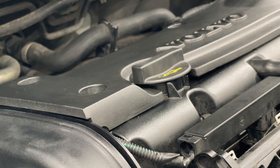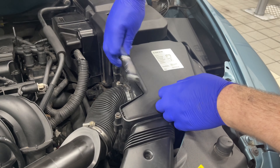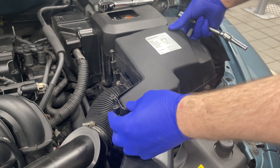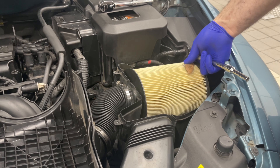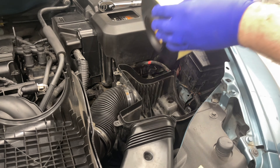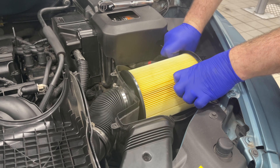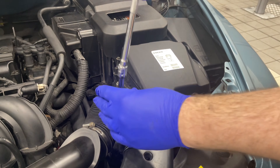Now let's move on to the air filter. Start by removing all the securing bolts on the air filter housing — these are 7mm and you may need an extension to reach some of the bolts. Once you take the cover off you'll see the filter. This one had served its purpose and was actually really quite dusty. The new one goes in and sits into some moon-shaped grooves on the lower part of the filter housing.